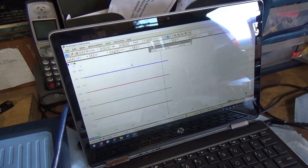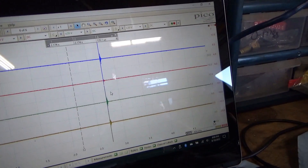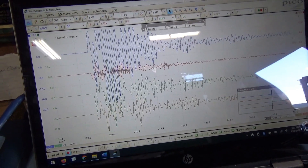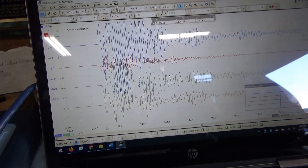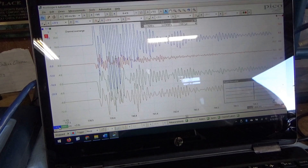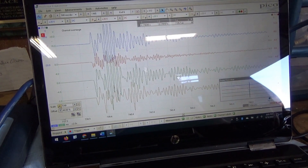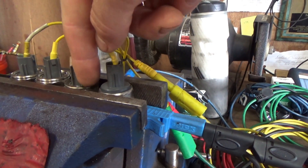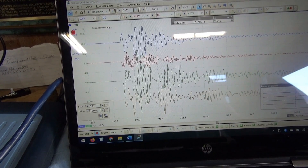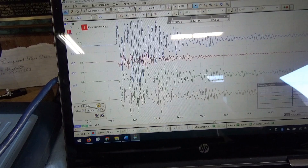Just one knock. Definitely something — let's zoom in. We see that the red is much lower amplitude than the blue, green, or yellow. The blue one is the OEM sensor and that one looks the best amplitude — it went off the screen. Now, it depends on where you hit, since I hit the vise right next to the bank 1 sensor, so that felt it more. But regardless, we can see that this bank 2 aftermarket sensor is garbage. The amplitude is much, much smaller than the other sensors.